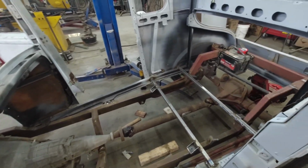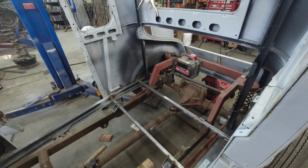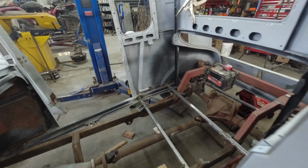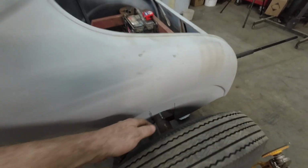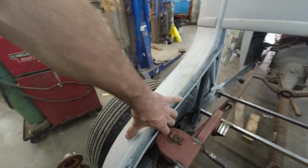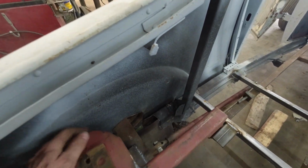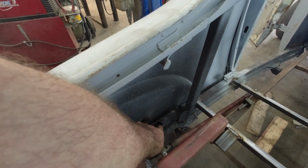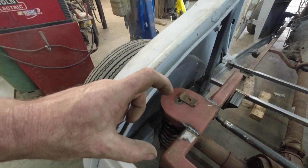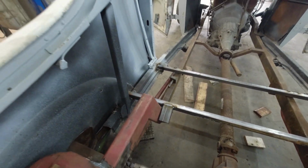All right. So I have that. Again, I'm going to drill a couple holes quick just so we have reference points that stuff stays where it's supposed to stay. And we'll have to do some more clearancing. We'll have to build up a structure inside of here because now the back half of the car, only this and the sheet metal's holding it. So we got to build a new frame to go up and around. It doesn't have to be very thick. It'll probably just be some 1 inch or something like that. 1x2, 1x3, whatever I used over here. If I get some more of that, that'll be plenty strong for that part.